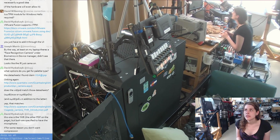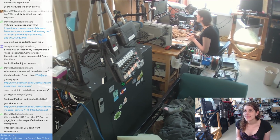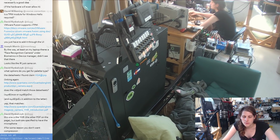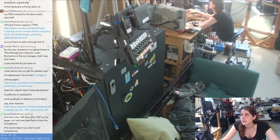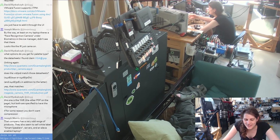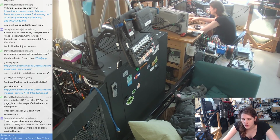So the YUV mode at 10 FPS, I realize that's much less compressed than the JPEG. It still is not RGB or before the debayering, which is what you'd want for more serious computer vision cameras, probably. But I just don't know what applications would want a little bit of extra image quality but at an unusably slow frame rate. Maybe surveillance cameras or something, but that wouldn't be useful for interactive chatting or for most things that a person with a mobile device would want that mobile device camera to do.